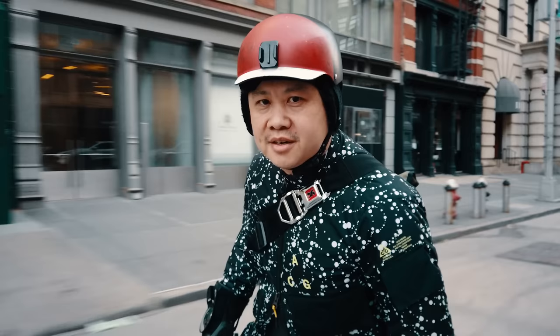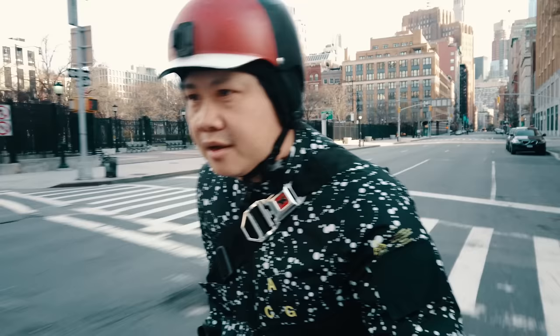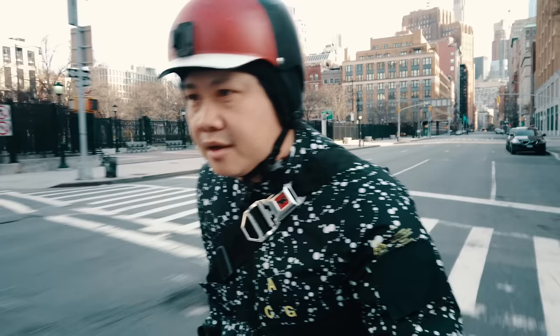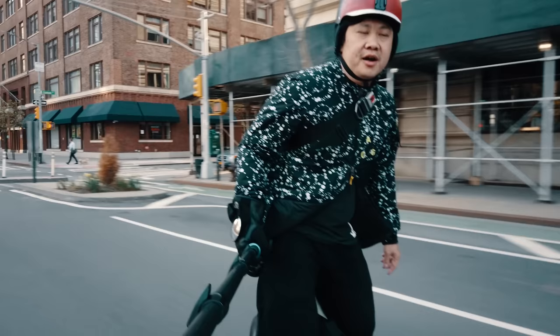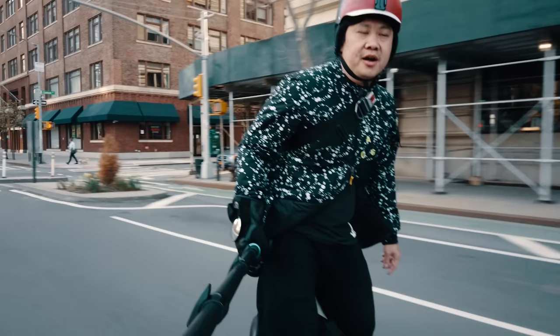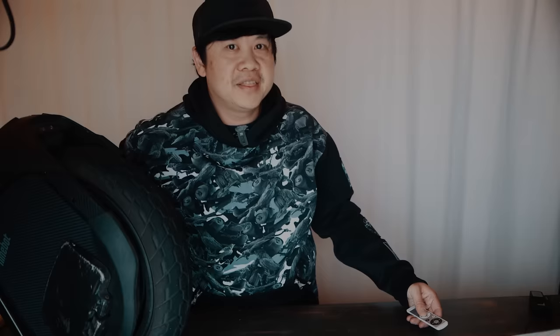This is the other reason I'm so excited about these two wheels — they represent two very different visions of how a suspension system can work on an electric unicycle platform. To discuss it in greater detail, we first have to talk about a basic concept: sprung versus unsprung. Sprung refers to the portion of the wheel that is above the suspension and being stabilized. Unsprung refers to the portion below the suspension that is attached to the wheel — essentially the bit that is getting jiggled around regardless of whether or not you have suspension. Usually you want to minimize unsprung weight, since the less mass you have on the bit that needs to move, the easier it is to move it.